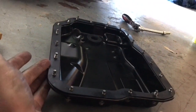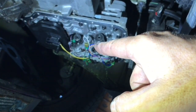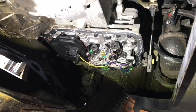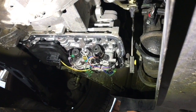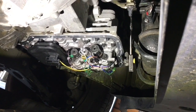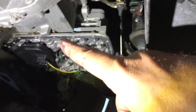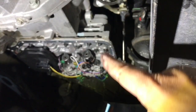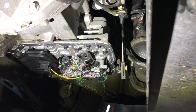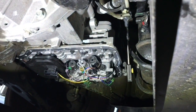I have all my bolts pushed in place through the gasket, all set to go. The pan is extremely clean. I've put in the new filter, hooked up the electrical clip, and the solenoid is in place with the eight millimeter bolt and the white wire connected. I'll put the pan back in place by holding it up by hand and tightening all the bolts by hand first, then doing a series of torquing. You always start in the center on one side, tighten it, then the opposite side, then do a clockwise pattern until they're all torqued to spec — this is 12 foot pounds.